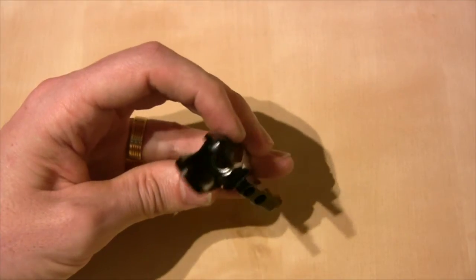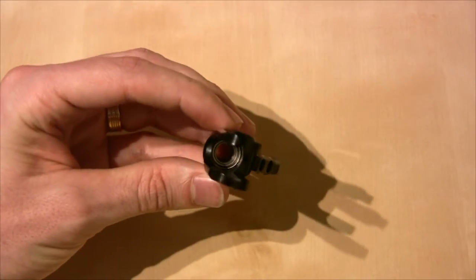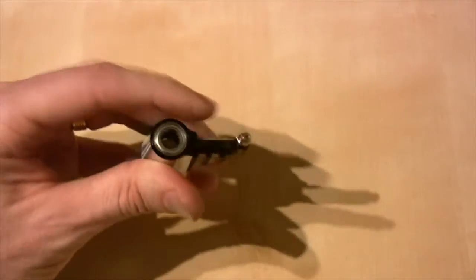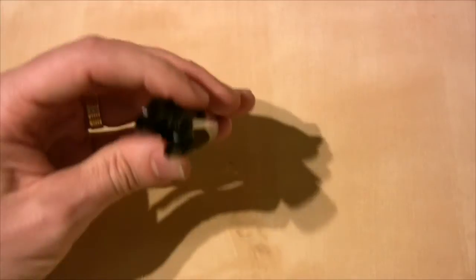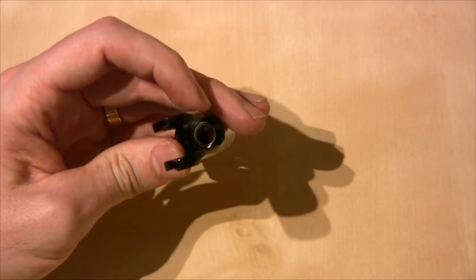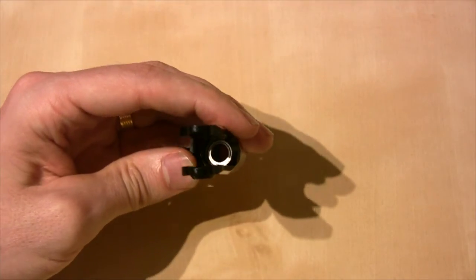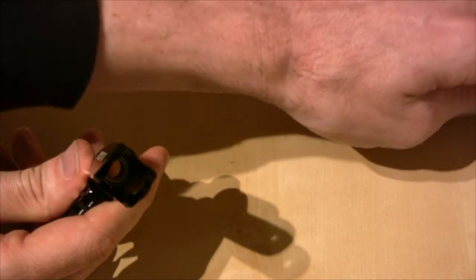We're now at the point where we want to install the blade grips onto the head block. There's a radial bearing down inside and another radial bearing on the other side. We need to put a thrust race in where that radial bearing is. The first thing that needs to go in is a spacer that spaces the thrust race outer away from that radial bearing — let's grab that.